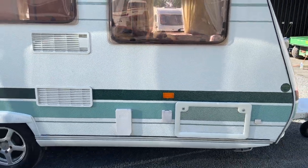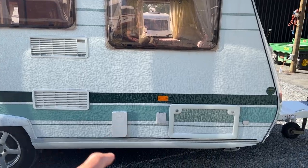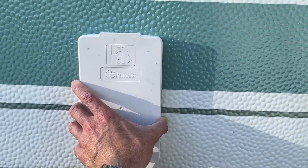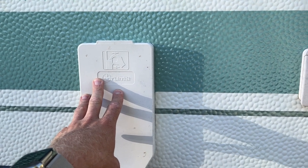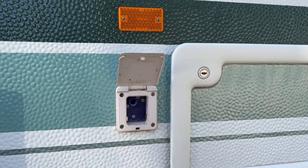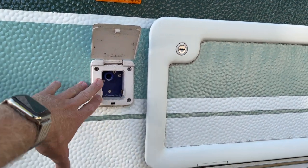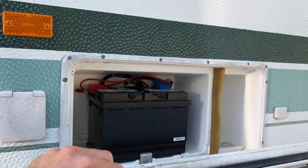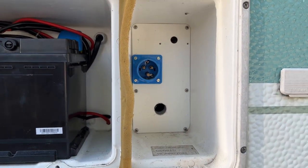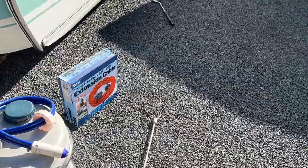At the front here, this is the back of your fridge. Down here is the back of your gas hot water cylinder. Before you run it on gas, you must remove this cover — this is where your LPG gas comes out. Here is where you attach your water pump; it plugs in here and the other half drops into the water tank — the caravan sucks water in through there. Behind here is our deep cycle battery and our mains entry port. It comes with a brand new 25 metre cable to plug her in, and this is a caravan-to-caravan plug. If you want to charge from a wall socket at home, you need to get an adapter from that end to a three pin wall plug.